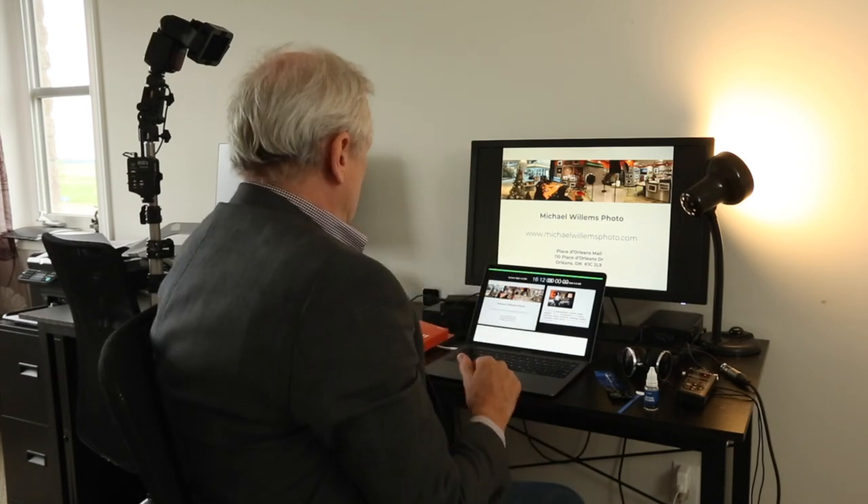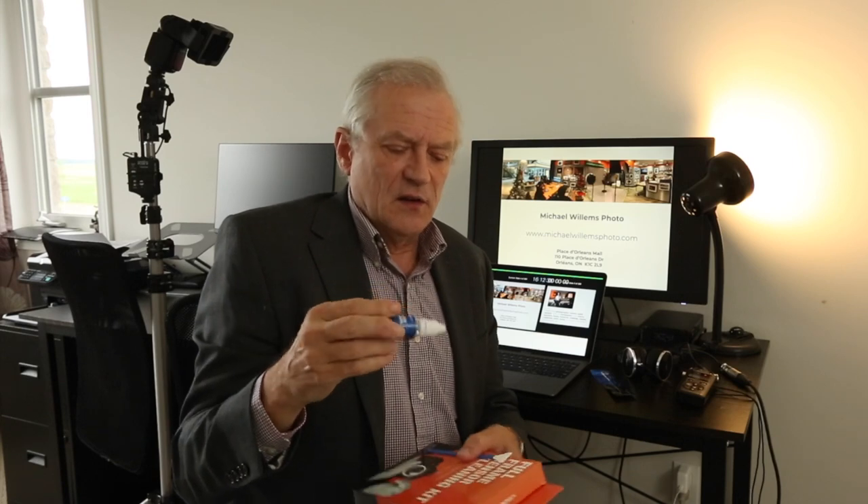So be careful. But if you want to do it yourself, here's how. You get a kit — this one is a full-frame sensor kit. The kit has to be for your size sensor because it contains cleaning pads, and these cleaning pads should be exactly the same size as the sensor in your camera — full-frame or APS-C — so make sure they match, otherwise the kit won't work.